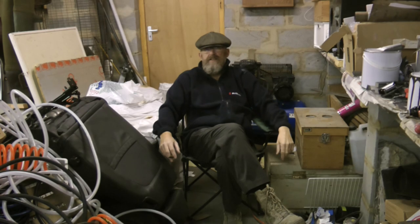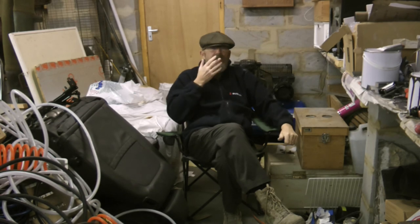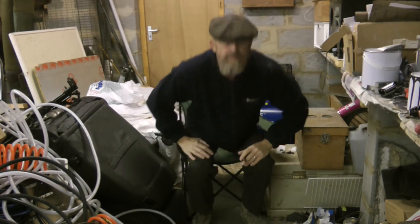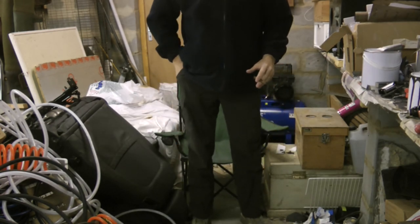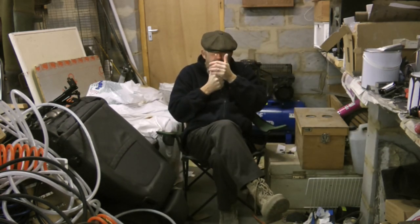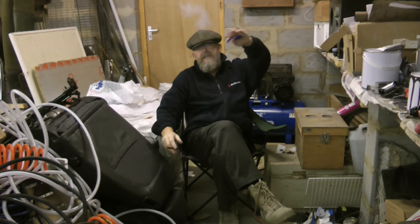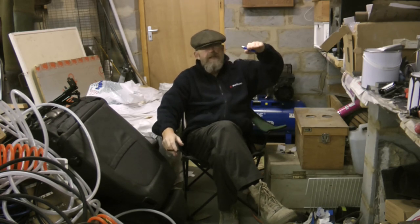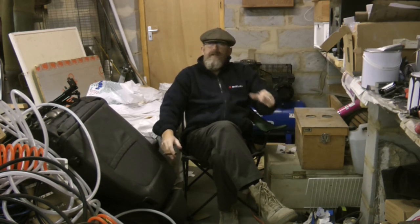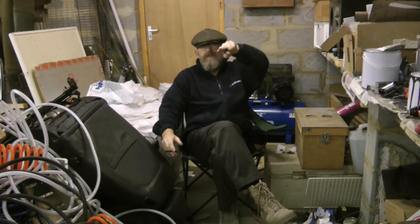What I haven't done yet is clear coated it. And that's one of the things that caused the original problem. I did have a good result on that back panel initially. What had happened was that the clear coat went on too thick. Where the hood attaches to the front of that panel, it sort of kicks up at a little angle, a bit where there's a little bit of spray over on the stripes video. And the clear coat had gone on too thick on there, and it didn't have a dip like that, it just went like that.